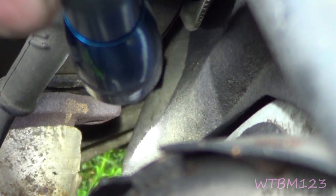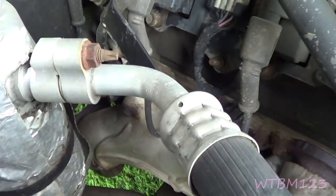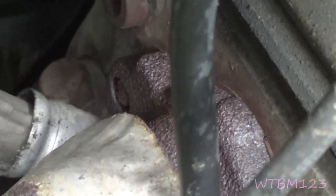You can kind of see the holes directly under my flashlight, so we're missing one. On this side we have one there, one there, one there, two together, one there. Right behind that metal tin, you'll see there's that plug right there in the head. If you look at the edge of the exhaust manifold, there's a bolt sticking out — actually there is no bolt sticking out. You can kind of see the bolt stud in there, but the head's missing on it.